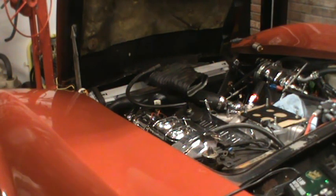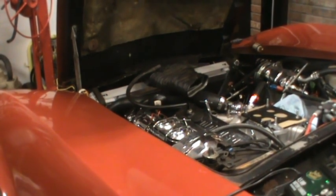And guess what? I didn't tell you this, but before I added that extra ground, the horn was not working. So I did need that extra ground. I did need that socket repaired. I did need the rear socket repaired. So there were a number of problems, but they all appear to be handled now. It's just a matter of feeding those things back through and hooking them up. Just for grins, I have some wire looms, and I'm going to maybe put the wires on those pigtails in wire looms as well, just to make it a little neater.